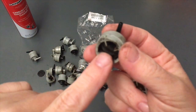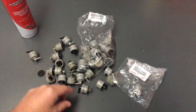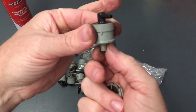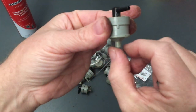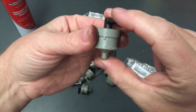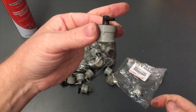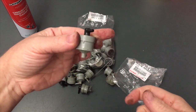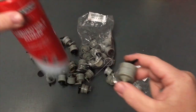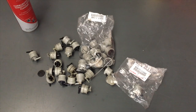If you want to avoid wrecking it when you clean it, allow more time. Spray your cleaner through, then just let it sit for 10 to 20 minutes — half an hour even. Just let it sit so the fluid can evaporate. It's a fairly enclosed space but it will evaporate. Or go really light with the air and then let it sit longer, because it won't dry once you put the vacuum lines back on and put it on the car.